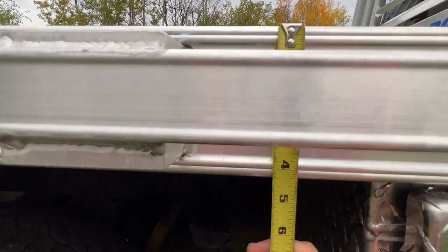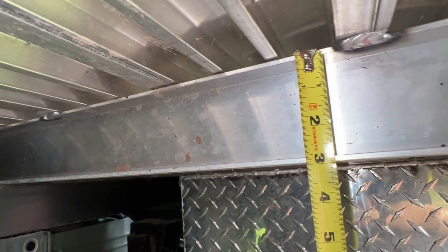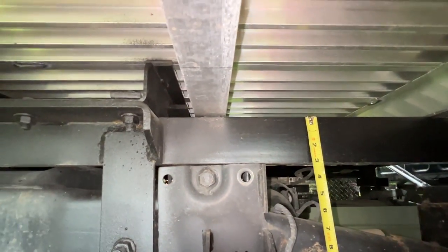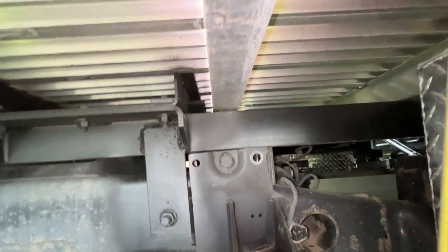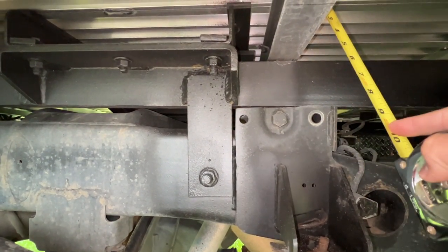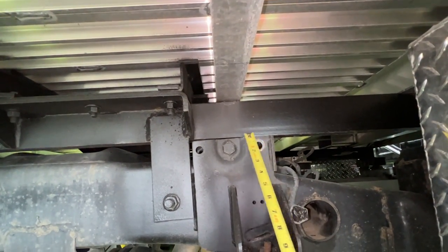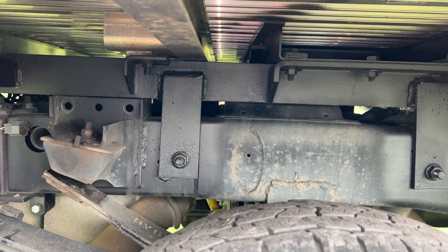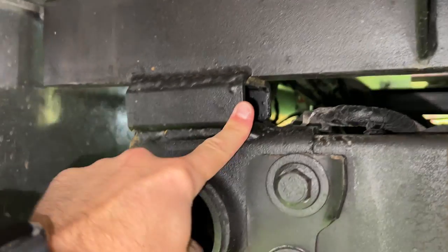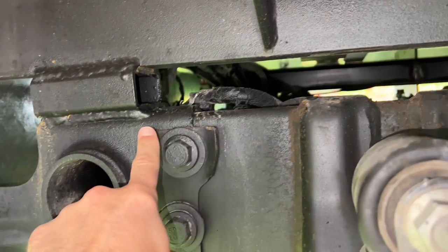The side of the bed is about four and a quarter inches high. The rub rails are roughly two inches. The main I-beams are three inches high and this beam is also three inches high, so from the plate it's three inches up to here, three inches up to there, and then one more inch up to the top of the deck — that's seven inches total. That steel strap is welded on and then bolted through. In the back they welded this rectangular tubing to the actual hitch mount — not to the frame itself, but to the factory hitch mount.